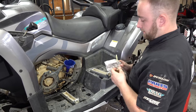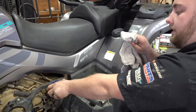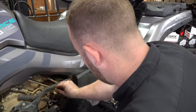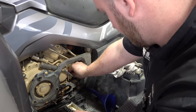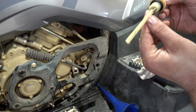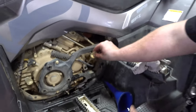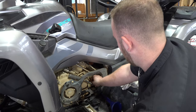About over 500 miles — I would do the transmission. And then differentials and stuff about every thousand. Unless you're getting water in them, something like that — if you're doing a lot of heavy mud riding, river riding, creek riding, you need to service them more often. Same thing with this one: don't screw the dipstick in — bottom it out, pull it back up, top mark's full. You don't have a filter or anything to fill up, so when that's full, it's just full. That's it.